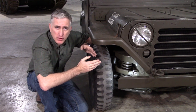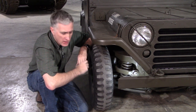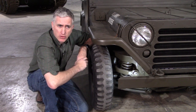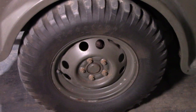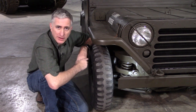Some MUTs had higher PSI — the M825 recoilless rifle version had 40 PSI as the designated road pressure. Originally the wheels were made of magnesium: nice and light, probably expensive, and also tended to burn well. So after a short period they were replaced by steel wheels with lightening holes cut into them.